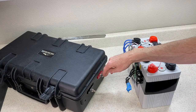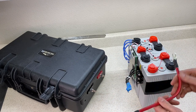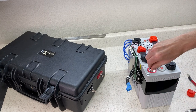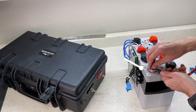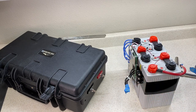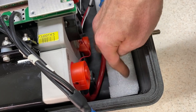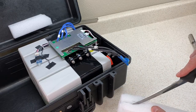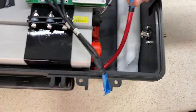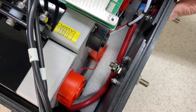For the first battery connection I need to connect the battery stud to the terminal using a 12-inch 4 gauge battery cable. I'll remove the bolt from the main battery positive terminal and attach the cable at the right angle, making sure the red balance lead is stacked on top of the cable's terminal end, then tape up the other end for safety. With the battery back in the case I can see there's interference between the cable and the foam, so I'll cut a little relief notch so the cable fits perfectly. There's a lot going on in a little space, so experiment a bit to get things right. If you mess up a foam block, remember you have lots of extra foam so starting over is cheap.